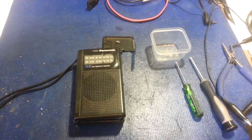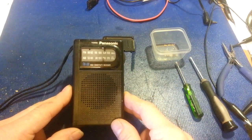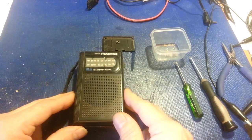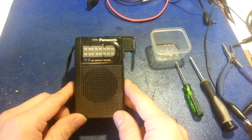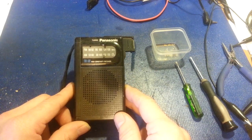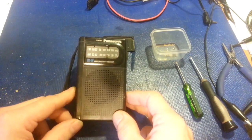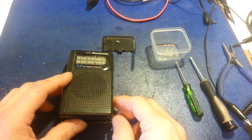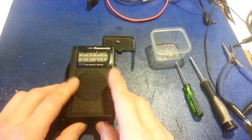The good thing is it's easy to clean off, a lot easier than people realize. This little radio belongs to my mother — she's in her 80s and she likes to use it in the kitchen when she's baking Christmas cookies for days on end. She pulled it out, took the battery compartment door off, and sure enough she'd left a set of batteries in it, so the terminals are corroded. Luckily, it's easy to clean off.